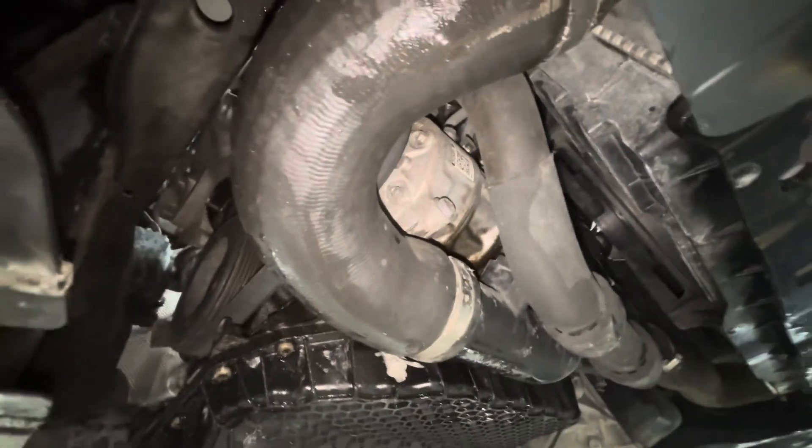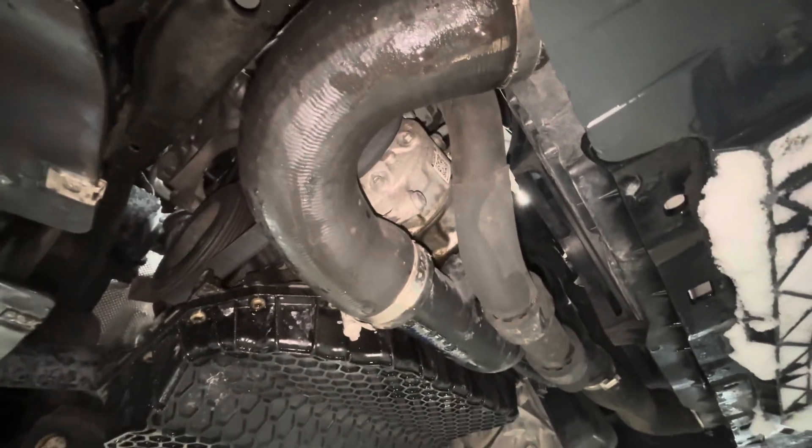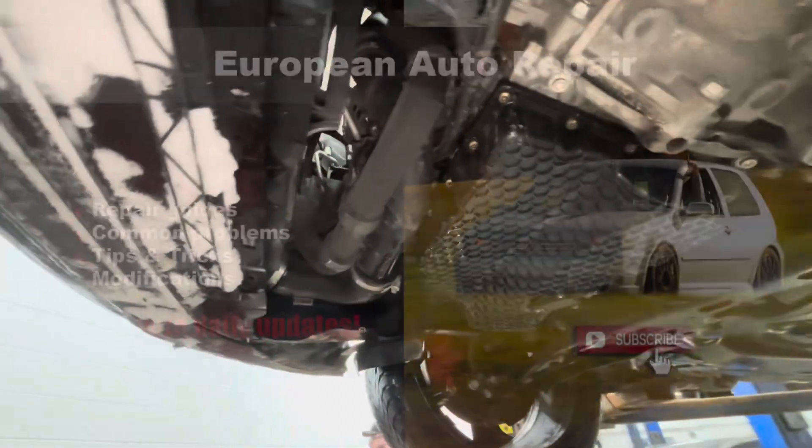What I like to do is pull the AC compressor and the alternator, and replace the oil filter housing gasket as well as the oil cooler gasket. This one's super contaminated so I'm likely going to replace the oil cooler altogether, replace the oil filter housing gasket, and then flush the system. So that's it — something to look for. Thanks for watching.